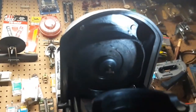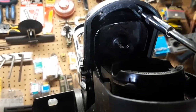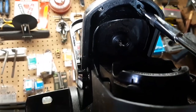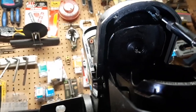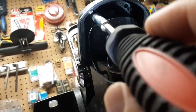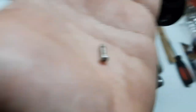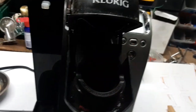There are two screws right up inside there. It's a Phillips number two bit. These are small screws - you don't want to lose these things. Use the magnet to hold them. That's just about out - there's a screw, almost lost it. Put it in the magnetic holder. So that's two screws up in here - four screws total holding this together.